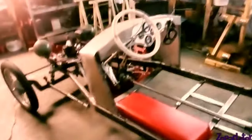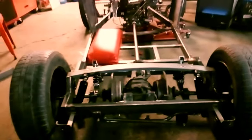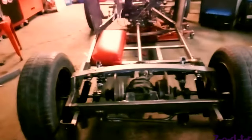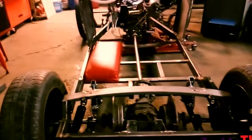What you see here is a home built, really. I'm building little parts here - everything I built myself. So now the suspension springs do everything they're supposed to do. It stays in this form until you sit in, so it is straight. In the beginning when you put it down, it would rest down and those driving shafts here go upward, the wheels turn to the inside from the top - that was a bit of a mess. Now that's fixed.